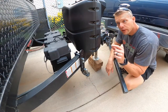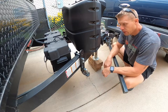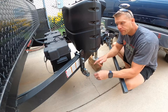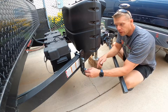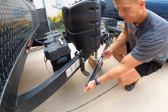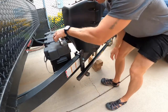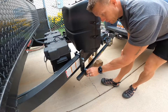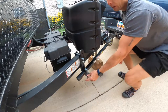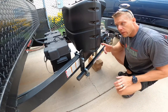Before you take all the weight off of the nose jack stand, you're best to take your stabilizer arms and get them onto the RV. To do that, take out the pin and swing the arm in, lift it onto the platform, then replace the pin and flip the latch down to secure it. The same will be done on the opposite side.